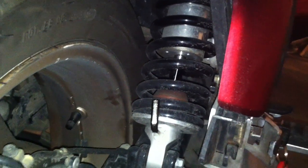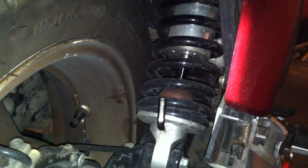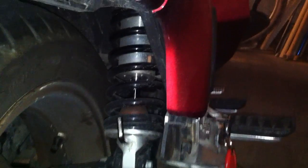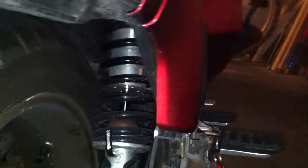After some feedback on the ST Owners Forum, it looks like this is a Progressive 420 shock. I've been playing with damping settings and you can tell a big difference between the different settings. Here it's set at 1, and you can see what the rear of the bike does as I compress it — it actually goes through a few oscillations before settling down.